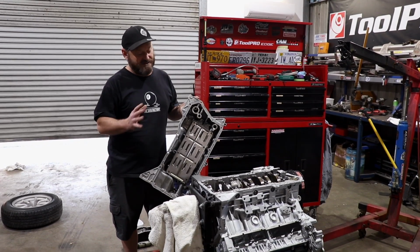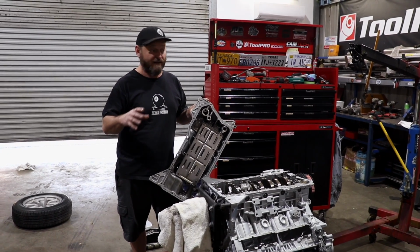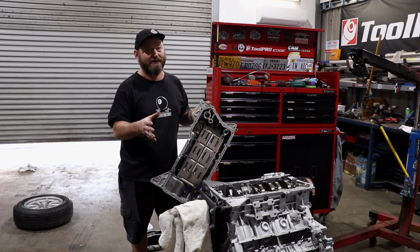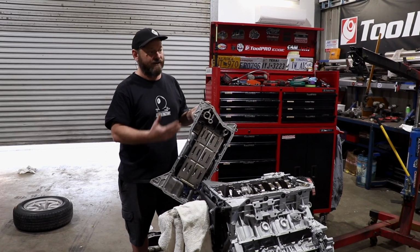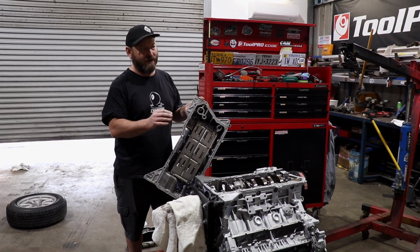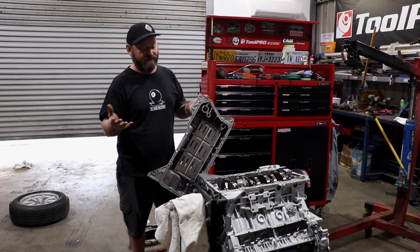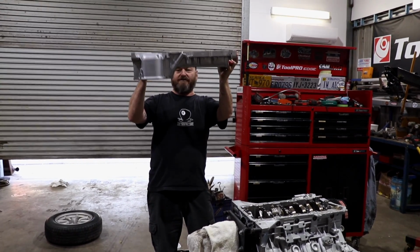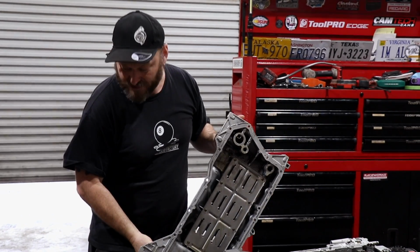We mentioned sump or oil pan issues in our video that we did about project planning. It's always probably the first thing you're going to come up against if your engine physically fits in your car: whether the sump's suitable. In this case, we probably could make this work, but we've been given a better option, so we're going to take that. You can see this is a rear sump. It's also off a truck, so it has a very long, deep well in it,